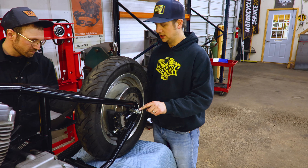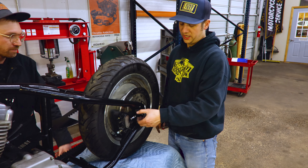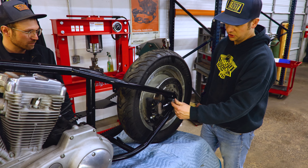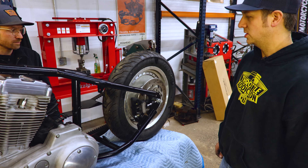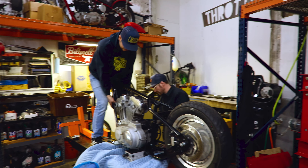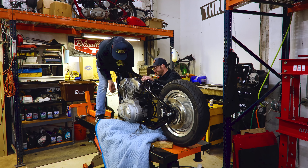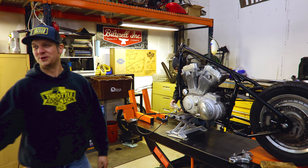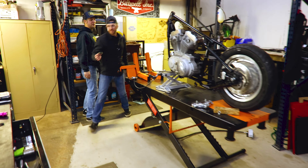Take a moment to drink while I do it — a little back and forth action. We still haven't called for anyone to sponsor us. We're a little surprised about that — they're probably intimidated, like 'we could never get those guys, they're too good for us.' When you use our hardtail kit, this is a stock axle. These spacers are the stock axle adjusters from your swing arm — you just pop them out, there's a stud welded on there, cut them off, put them on each side. Nice space for these axle adjusters to push against. Use your stock axle — if you're cheap and want to use what you got, it's kind of designed just to run that way.